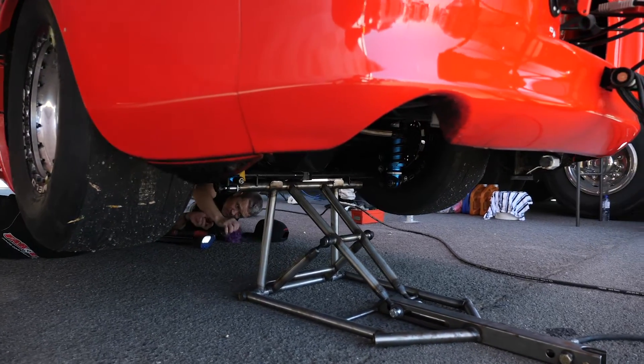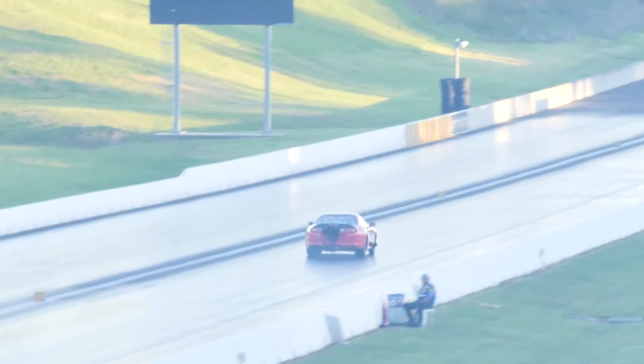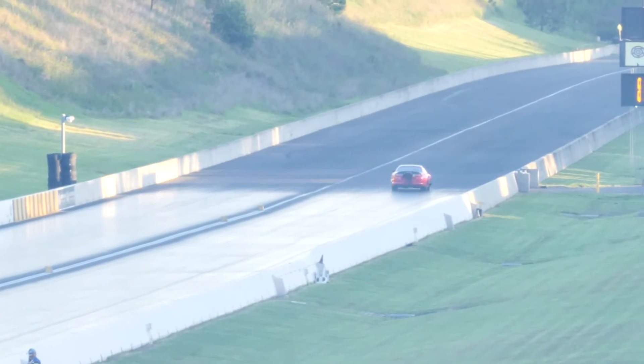Now one obvious and fairly dramatic change — factory Supra obviously has an independent rear suspension design, and you've gone with a live rear end which is common in drag racing circles. Can you talk to us about the advantages over an independent rear suspension? The biggest advantage is strength and being able to control the tyre, the footprint of the tyre on the drag strip. With independent rear end suspension, when the suspension travels the camber changes, the toe changes — it's a lot harder to keep that tyre planted. So for the guys that are still doing the IRS thing, it's really cool to see what they're doing.